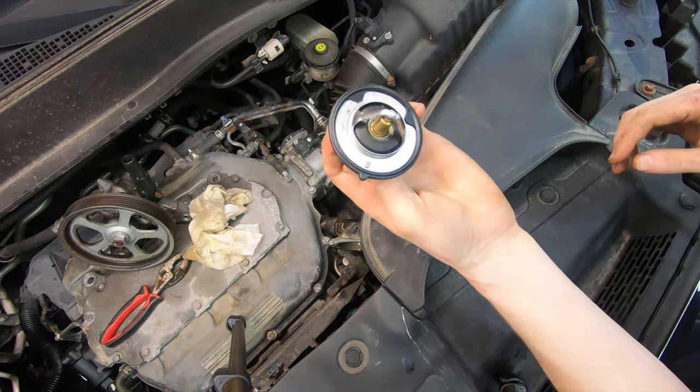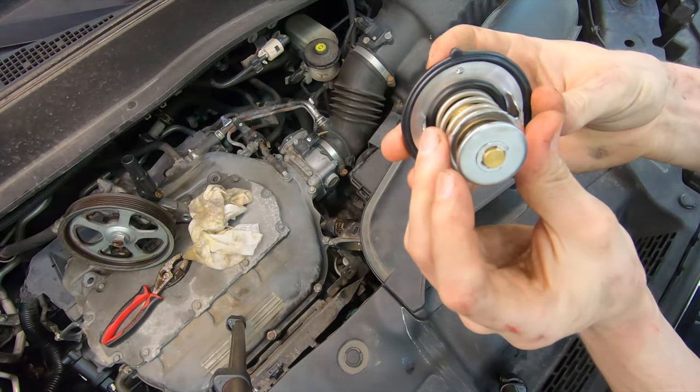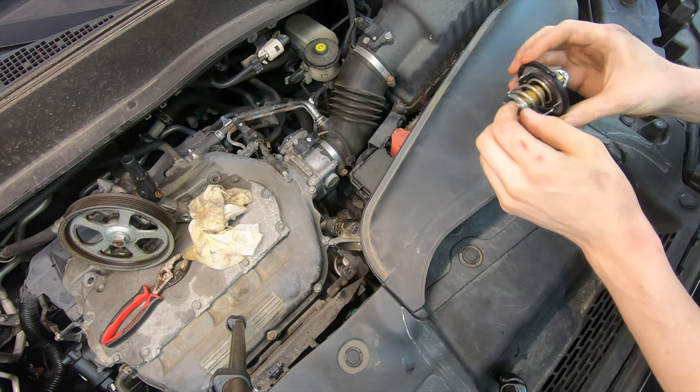I found concentrated blue Asian coolant online — about $25 a gallon, not exactly cheap — but if you're going to flush the system, that's the only way to get your coolant-to-water ratio right when pouring concentrate in. I'm also going to replace the thermostat while I'm in here — the car's 10 years old, 105,000 miles, I'm already in here, and the coolant's already drained. Thermostats are about $10 to $15. I'll flush everything out, put a new thermostat in, clean everything up, and bring you back when I'm ready to start bolting everything back on.